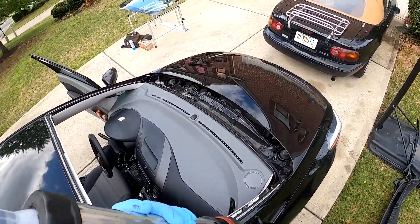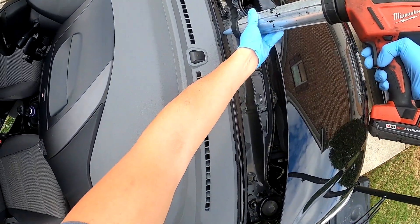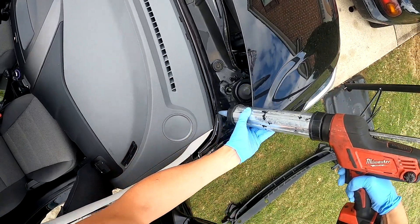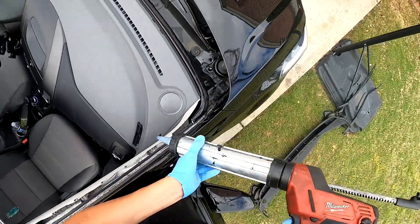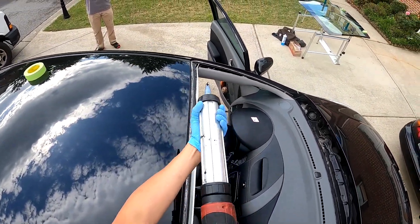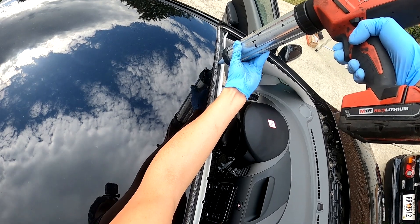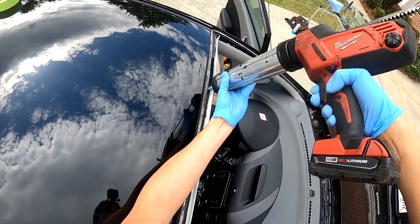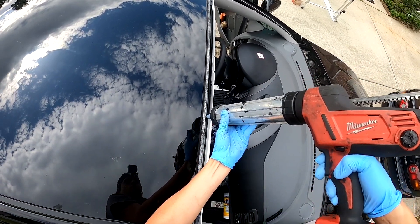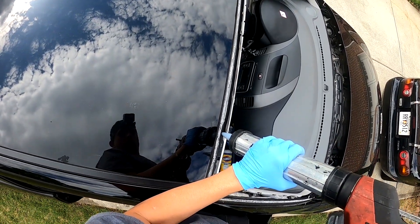My shooting technique is simple. I like to step inside the car and always start on the bottom. Occasionally you can get a weird blob on your caulking tube, so start there. I use my Milwaukee battery-powered gun. Start at the bottom, make my way all the way to the passenger corner, and go up just a little bit on that corner. When shooting the top, reach as far and comfortably as you can while keeping the gun up. Make sure that V is facing straight toward you. The nice thing about saving the old underlay molding is it acts as a guide when shooting the glue. Skin time on this urethane is usually 10 minutes, so go slow.